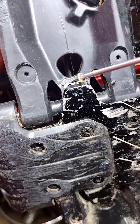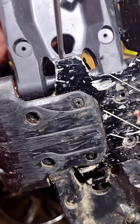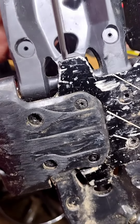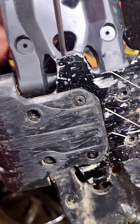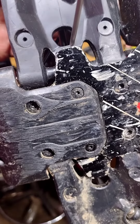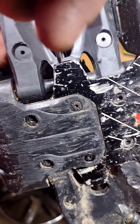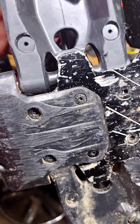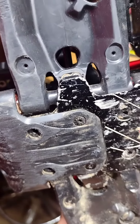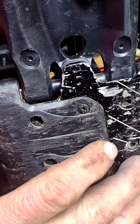So I put a washer or a shim in between it. Now when this screw is all the way in there, there's no way it's going to mash it in any further — it sits down inside of that cavity. I had to take the angle grinder to both washers and grind off just a smidge so that they would sit down inside this cavity. Some cars don't need that, but on my 6S's I've had to put like five or six washers in there to make up the difference.